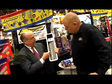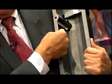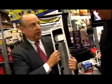Now, if you look here carefully, you will see that this is a recessed flange. The significance of this recessed flange is that it gives you much more internal clearance on this side, so you can put a large valve train in. Mostly die cast valve covers cannot have undercuts. Because of the way this is tooled, you can have an undercut and at the same time have the clearance that you need for a large valve train setup.